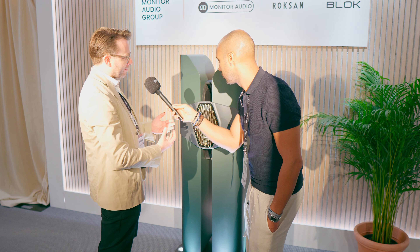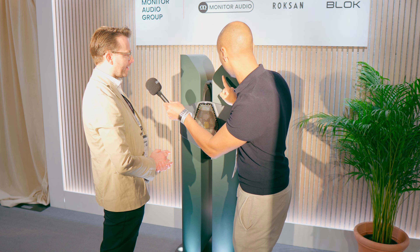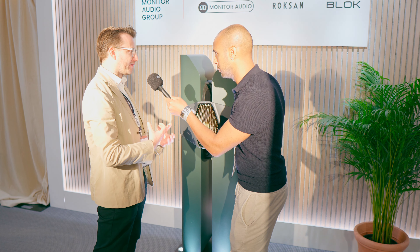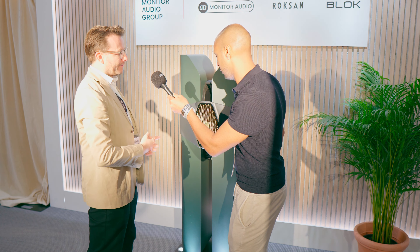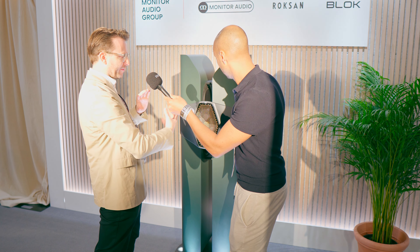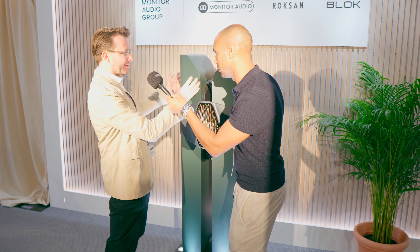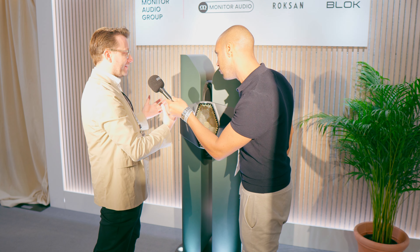And then obviously the other big feature is the split cabinet. The cabinet itself is made of a solid surface material, which is an acrylic polymer with a very high mineral content. And that makes it very, very dead — really, really rigid. Because the drivers are force-canceled, there is no vibrational energy being developed by the bass drivers. But there's still air in the cabinet moving very quickly, so that generates energy as well. So we still need a really rigid cabinet, so we use this material. It's incredibly dense and incredibly heavy.